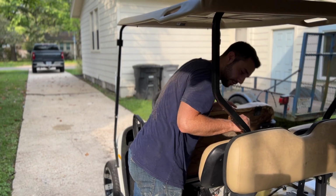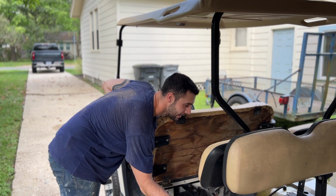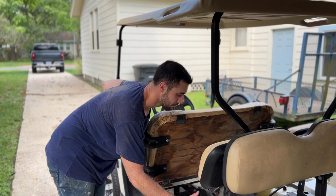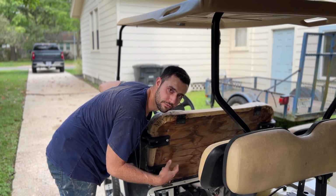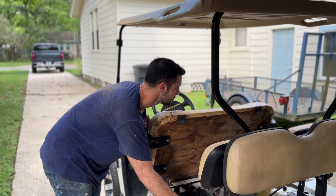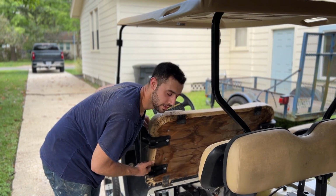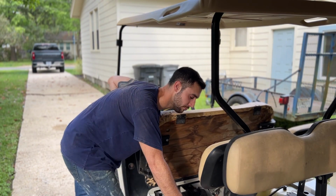Don't touch exhaust. So I think we got a couple things going against us right now. We need a carb kit and we need a new belt. The reason I know we need a carb kit is because there's not enough fuel being pulled into the actual carburetor. Even when I go full throttle, it's not getting enough, but every time I choke it, it'll light off. So we just need more fuel.